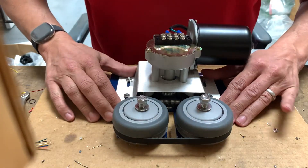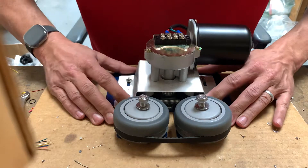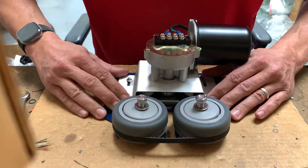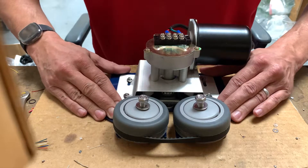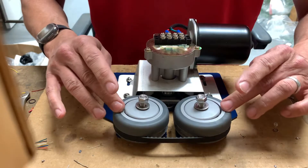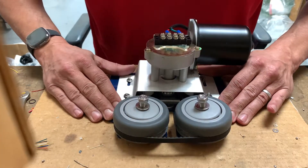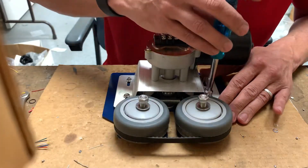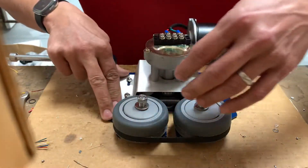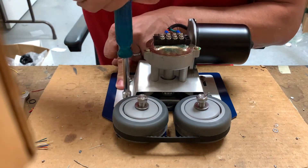You'll see that the bracket is probably pretty close to the bottom of the slots. If you pull down so you see a little bit of blue underneath, you should have some little rings on there. The important thing is it should start making the wheels bend inward, and if you try to push them flat you'll see it moves the bracket up. Put them down and re-tighten, making sure you have about an even amount of blue showing on either side.